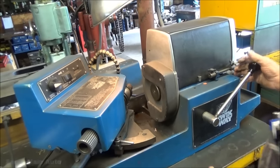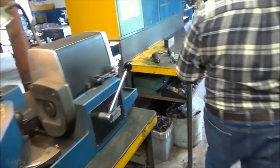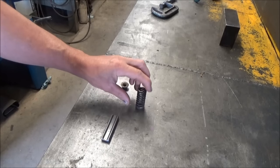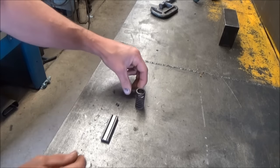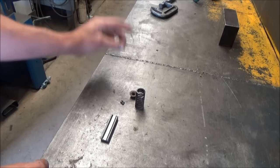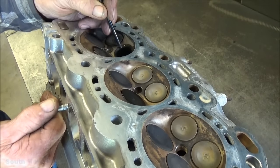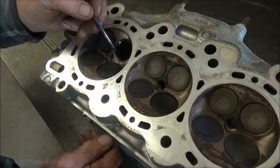I can clean it and make it more visible. They're sandblasting our valve. Here's our valve spring that he took off, and then we've got the retainer and the valve keepers right here — those little tiny suckers. As soon as he gets that cleaned off we're going to stick it back in the valve grinder and get a closer look at it. So look here — got carbon there on it. Here's your seat right there. This is all carbon here.